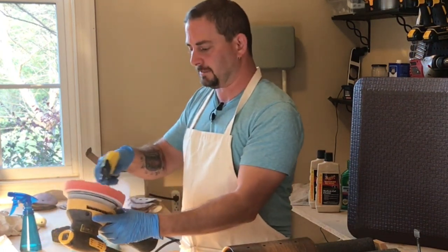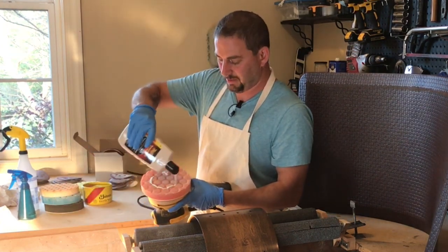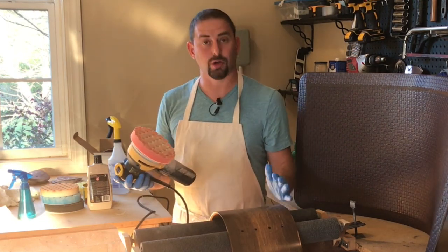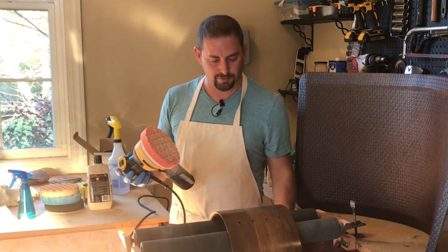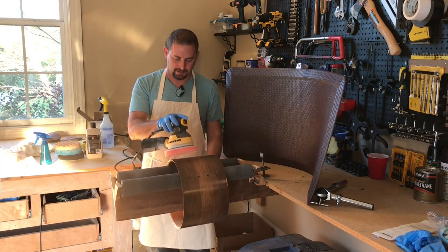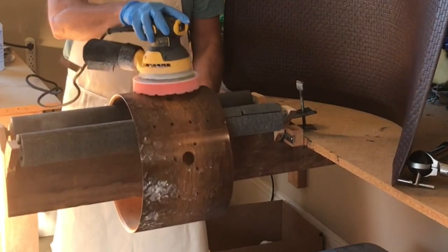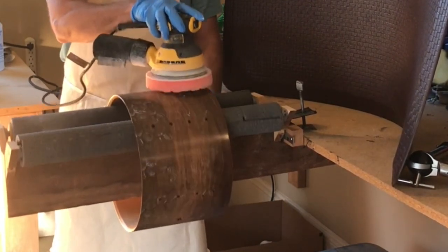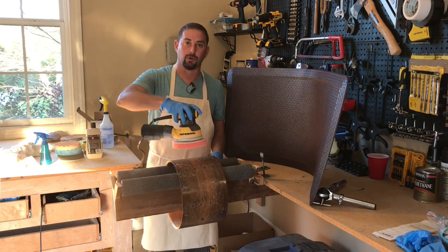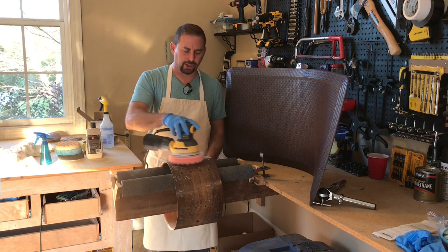Step one: I'm just going to lubricate this pad up a little bit with some water. Step two: I'm going to take our heavy cut cleaner, shake it up, apply it to the pad — not crazy, just a little swirl like that — and then spread it around a little bit. This is going to spray all over the place, so I put a very light layer of water on the shell itself, and to minimize mess I'm going to dab it — putting these little honeycomb hex shapes right onto the shell so I can tell exactly where I'm putting the compound, making sure it gets all the way across the drum. Now I'm going to make sure the orbital sander is right on top and turn it on. Make sure you keep it moving.